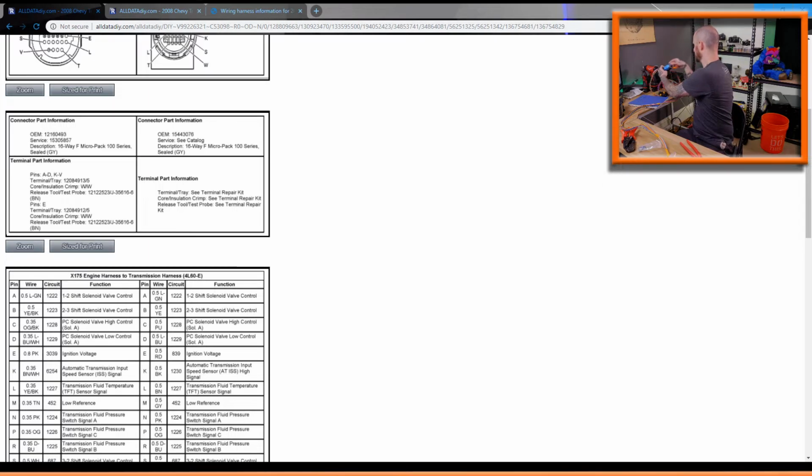This harness is about, the wires come in this ECM already set up at about 15 feet long. So I've got it marked back here as to where it's going to pass through the backrest of the seat and where it actually goes into the trunk, because I'm trunk mounting the ECM in this car so I can hide it and also still make it easy to access in case we want to do anything special.